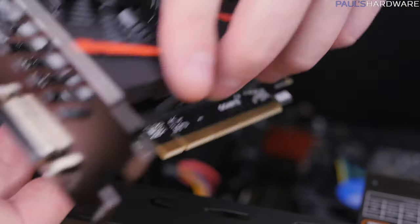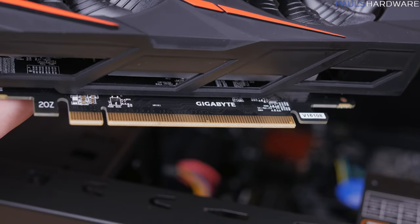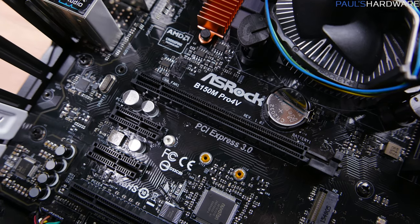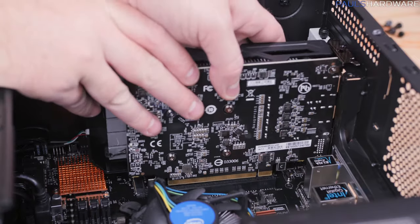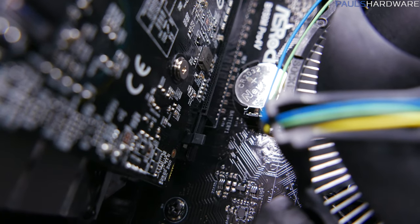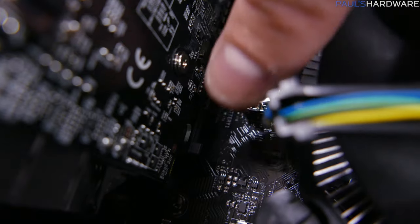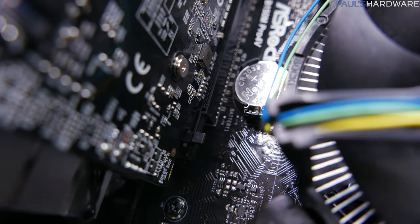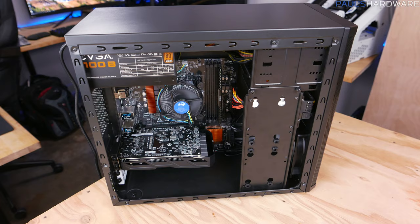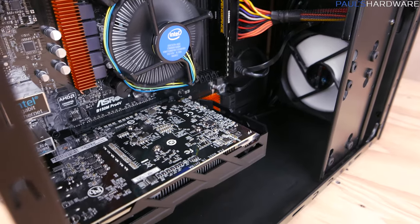Finally we have the video card. It has a long PCI Express connector on the bottom which also has a notch close to its bracket. Line this up with the PCI Express slot on the motherboard that is closest to the CPU, and the graphics card should drop into place with just a bit of firm pressure. There is a catch on the motherboard slot that you might need to slide to the unlock position to install, and then back into the lock position once the GPU is in. Secure the back bracket with the two thumb screws, and you're finished with the build part at least.